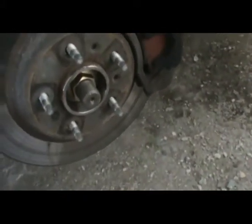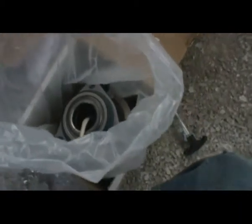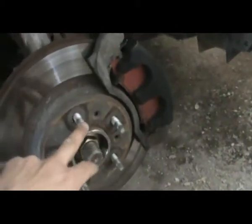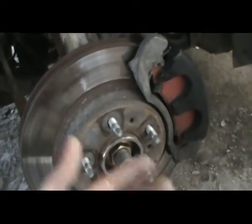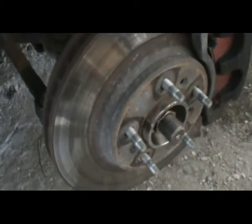We must have driven over something and ripped the cable. But in a way we're lucky because we're changing the hub — the bearing — and this one is busted too, so we're going to have to change it. We bought a new one — it's an economy hub. I always get the cheapest because we go over so many potholes and go off-roading a lot. We're going to have to take out the caliper and pull out the disc, and the hub will be behind the disc brake, held by three screws. We'll put the new hub and reconnect the wires, and that should take care of the ABS lights, the brake assist, and the traction control. As the wheel spins, the hub sends an electromagnetic signal through the wire to the car's computer, and the car knows if the wheel is slipping or spinning.